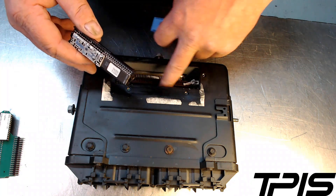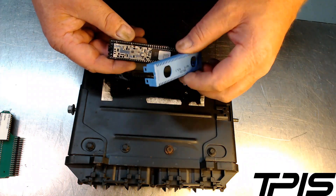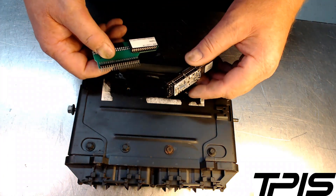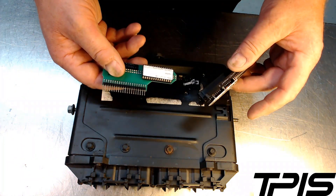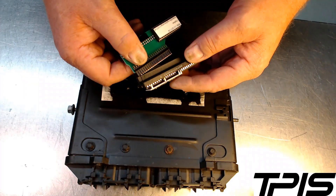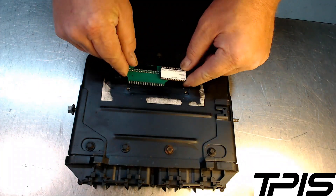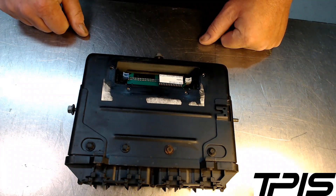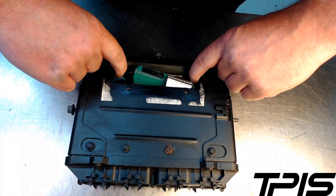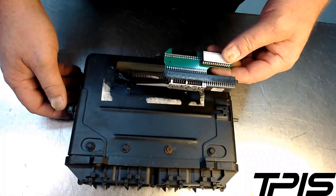You can see this heat sink bar here — sometimes that can get in the way if you have your blue cover on your factory memcal, so I just take the cover off. You can throw it in the glove box or keep it somewhere you won't forget. It's the same deal: remove the factory PROM. We use the same memory adapter for all these ECUs, so it's a very straightforward install. Just snap this on, make sure the two chips are on the same end, roll it in there, and push it down. Those tabs come up. If you need to take it out, the tabs make it really easy — just push them down and it lifts right up. That's 90 to 92 Corvette.